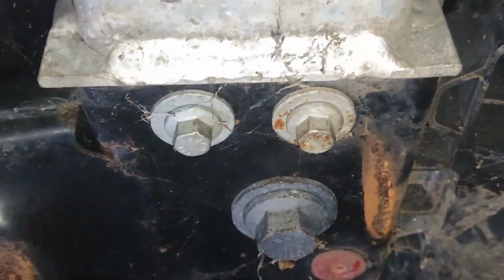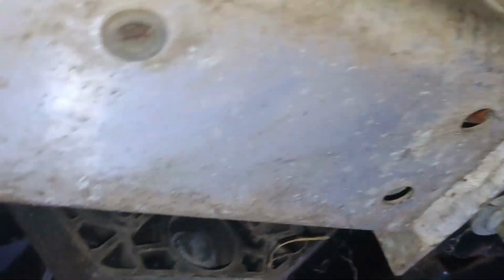So basically, if you want to remove the whole entire engine, I think you will need to remove these bolts, that bolts. Of course, you have to have support of your engine, right? Otherwise, it will fall down. So look, this aluminium guy, see, it's connected to the subframe, right? I believe you need to remove the radiators. You need to remove the front bumper, of course. You need to remove this crash bar, aluminium one, and support of the radiators frame.